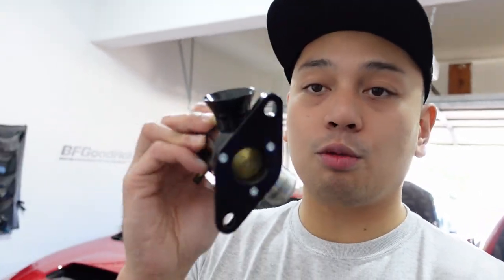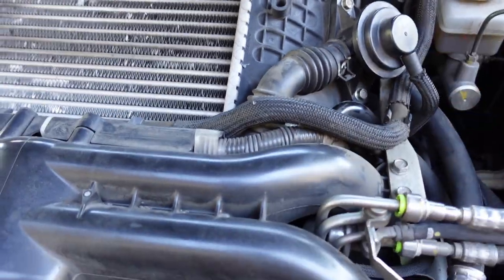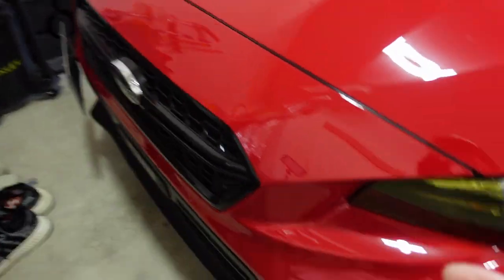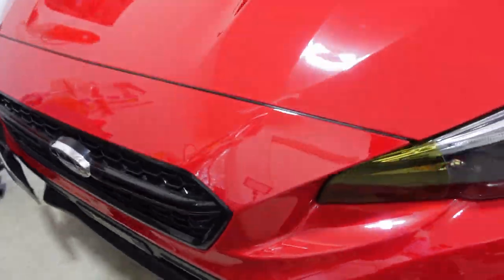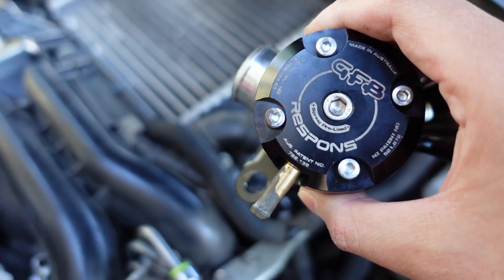It should be pretty quick — literally two screws and a tube from what I can tell. With these cars, it's not recommended you replace the stock bypass valve unless it's cracked or your fuel trims are off, but I just want to play around with the 2008 Legacy since I bought it as a beater and it came with one of these. On the EJ, the stock bypass valve is literally right here, whereas on the FA's it's all the way under the car and painful to get to.